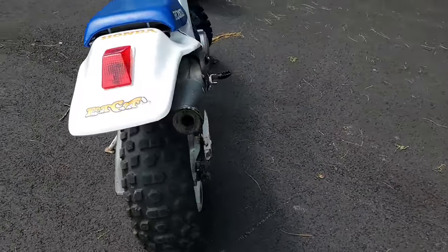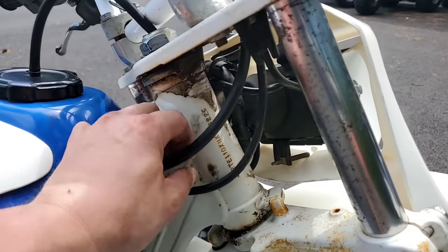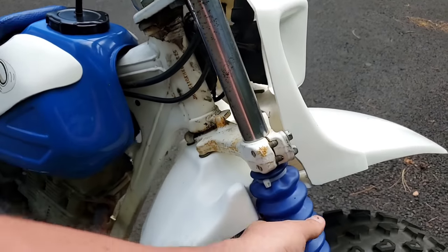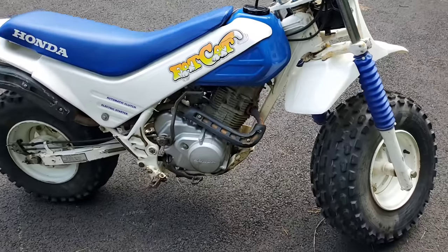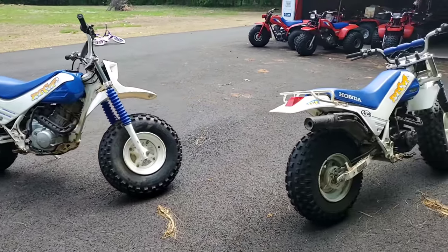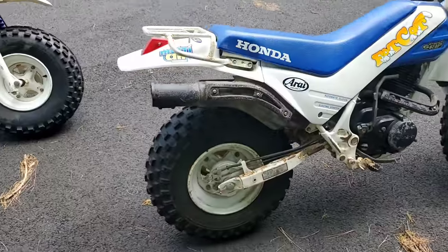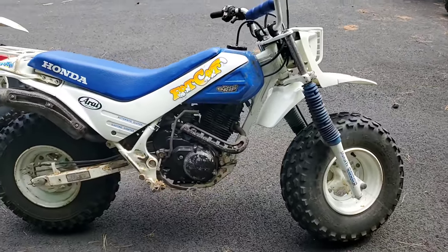Let's look at the brakes — drum brake, front and rear, not hydraulic. This is the 87, denoted by the H right there, J for made in Japan. The forks are thin-leg guys. These are not correct fork boots — as far as I know, they don't make a reproduction super similar to the original on these, which is kind of unfortunate. The exhaust guards appear to be the same shape year to year. I thought I noticed a difference, but it's just the angle — this one just needs some love.